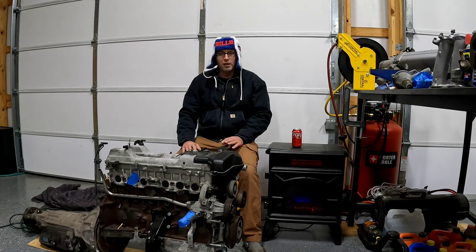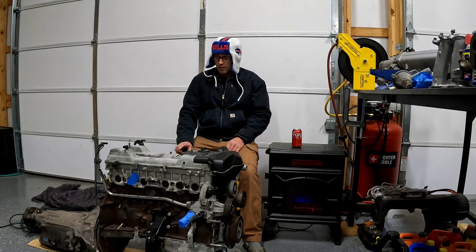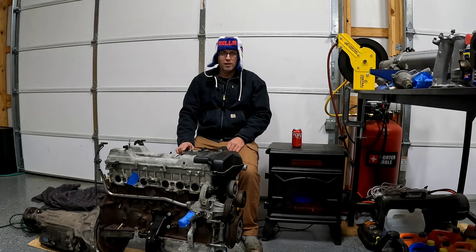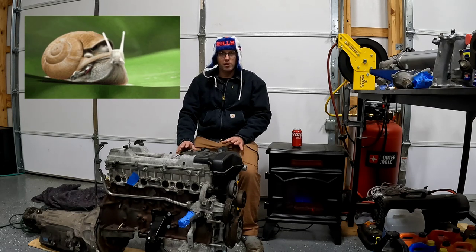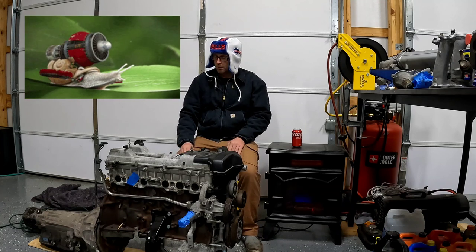Really it doesn't matter which version of the engine you get. If you get it out of a junkyard, you can build it. Now these motors — the GE VVT-I that I have — the rods are super thin compared to the turbo motors, and the accepted horsepower number they can handle is about 450 horsepower. My goal with this engine is not to go crazy. I just want about 350 to 400 horsepower. I want reliable. So I'm going to run a Toyota Supra Aristo ECU — I got one off eBay for like 300 bucks.